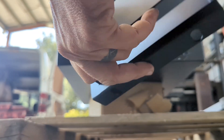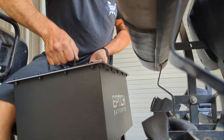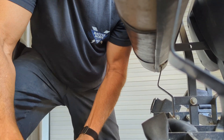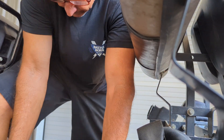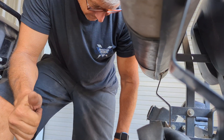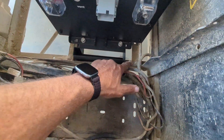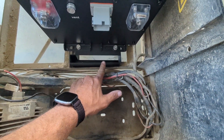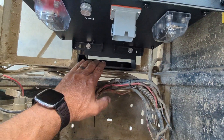All right, let's do the other side. Fits right in. What you didn't see was the bracket fitting right into this tray slot where the six-volt lead acid batteries used to fit, so we have a spot to drill a hole here and here and lag bolt it down to the frame.